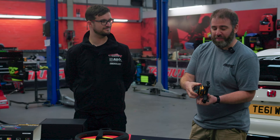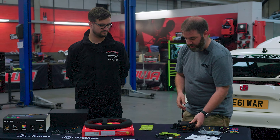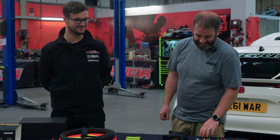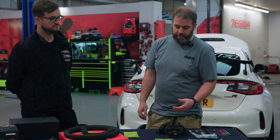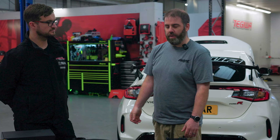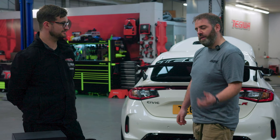And there you go — that'll be a lot easier when it's actually mounted on the steering column. It's a really nice slick movement. Now first thing we're going to do — whenever we have an airbag off a car — is disconnect the battery and leave it a good 15–20 minutes, or however long Honda recommend, to power down all the capacitors in that system. The last thing we want is best case an error code, worst case an airbag going off, because they're pretty violent.